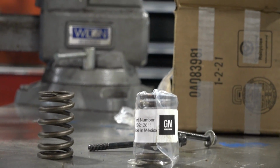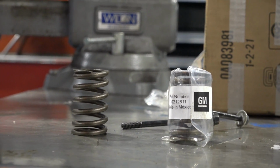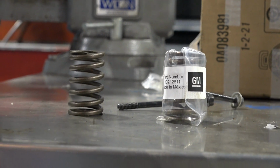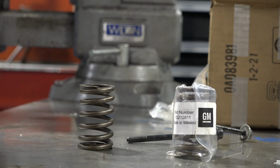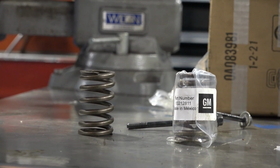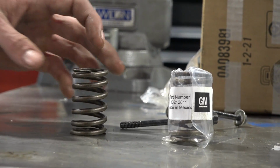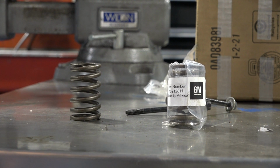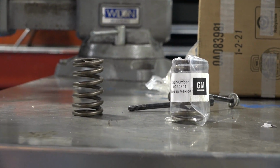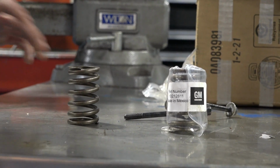So you told me that the valve springs are not always the same, and you simplify this, basically a spring tester. As you squish it, you'll see how strong or loose it is. What's the proper term? I guess it'd still be a load rate machine. You'd take your installed height and you would squish it to your installed height. And I know when I was at Enders, we would take them all and then we'd line them up from heaviest to lightest and then completely mix them all up.